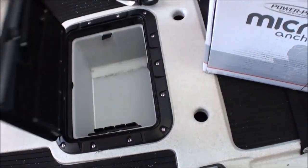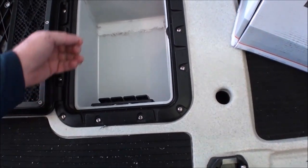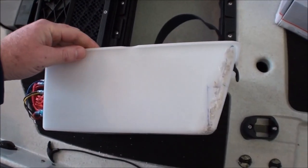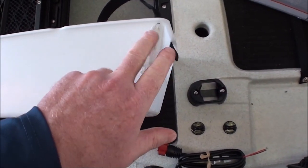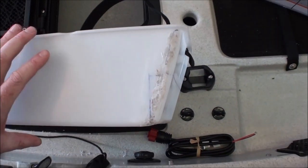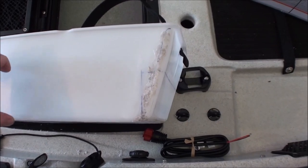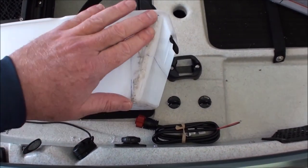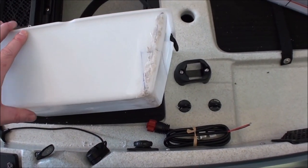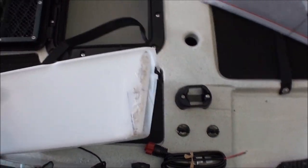I seem to have solved the dilemma of the hatch bucket popping in and out with the switch panel installed. I'll show you a quick little modification I did. What I did is sectioned out a triangle section here and cut that out on both sides, cut the bottom. I'll show you a quick picture of the layout. Once I got those sections cut out, I managed to do a little plastic weld — a little sloppy, but it'll do for now. I've got to invest in a plastic weld iron. That seems to be working fine — bucket drops in and out easily.